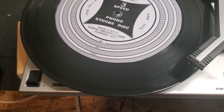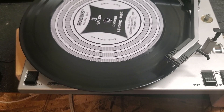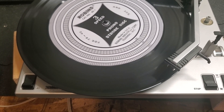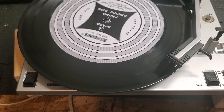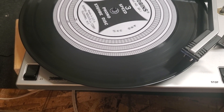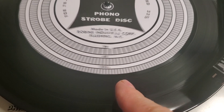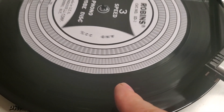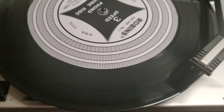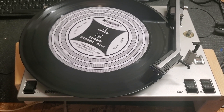What I have on there right now is a 13.6 square belt, slightly thinner than the original, and I've actually been able to make it back off by a couple of RPM and get pretty close. You can see that outer ring there — that's the 33. It's not perfect, but it's slower than it was when it was chipmunking. So if you ever want to do that on all these cheap units, you can try that. Take care.